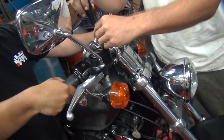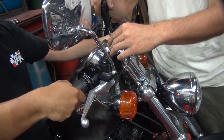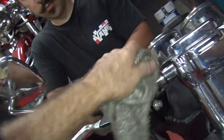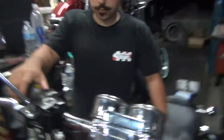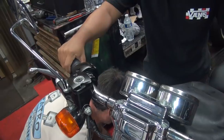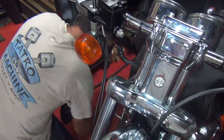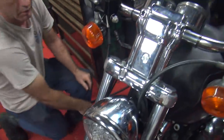I always thought bleeding brakes was a little harder. Now when you tighten the screw down, when you start to see the rubber just pooch slightly on the corner or in the middle, it's tight. And the end result is — does it work without having any air in the system? Put that all down. We've got to make sure there's no leaks. Okay, that's it. Put your finger on the lens. That's good.